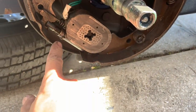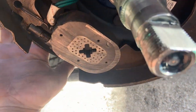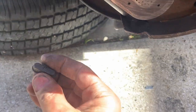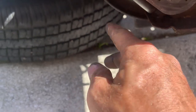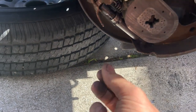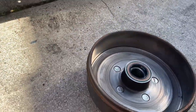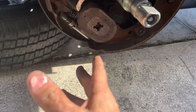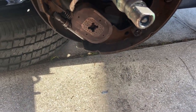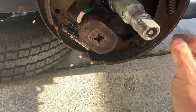A bit about brake adjustment. You turn the star wheel to adjust the brakes, normally done through that little opening in the back with what's called a brake spoon — a screwdriver-type tool with a curve to it. But I just use a pair of pliers and turn that, keep test-fitting the drum until I get close. These brakes are already worn in, so you want them just barely touching. They'll seat in a little once you apply the brakes and things settle into their original places.